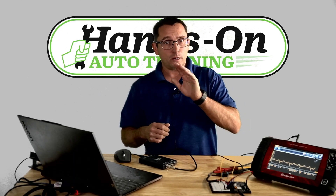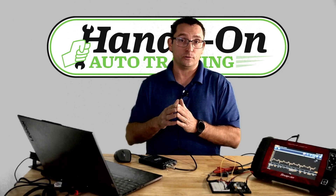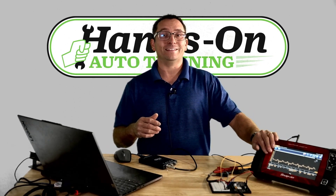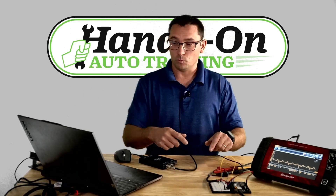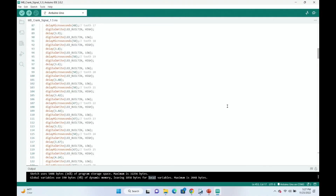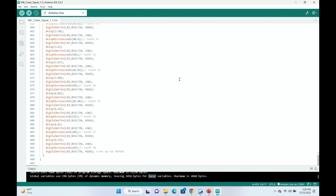If you remember that Mercedes-Benz crankshaft sensor I had a while ago — the 2015 GLA 250 that had a piece of rust on a magneto-resistive sensor causing an extra tooth — the shop had a Snap-On scope but they weren't able to capture the fault. They didn't see it because they were looking at just the scope side of things, not the graphing multimeter. I made a demonstration board, an Arduino project right here, and the sketch is available. The code is pretty simple but it's all true to the real vehicle. All this is up on the website.